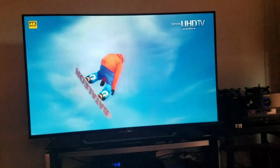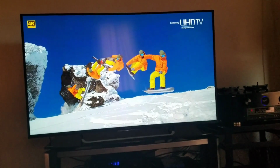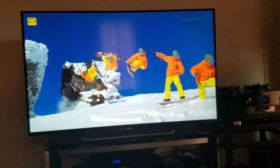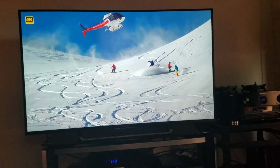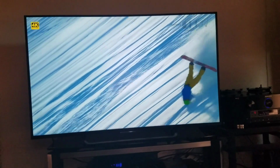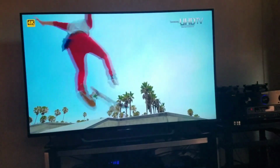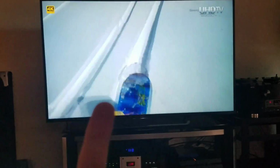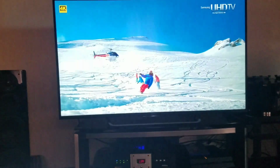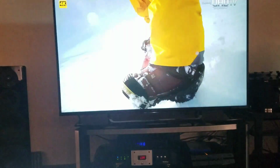In order to maintain compatibility with millions of devices in consumer homes, Atmos in these codecs is implemented as a backwards compatible extension. What that means is Dolby Atmos data is hidden within the bitstreams and can be decoded by a Dolby Atmos compatible AV receiver, but also a soundbar and a television. So three things there: receiver, soundbar, television can actually decode Atmos, guys.